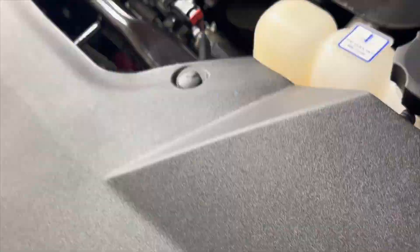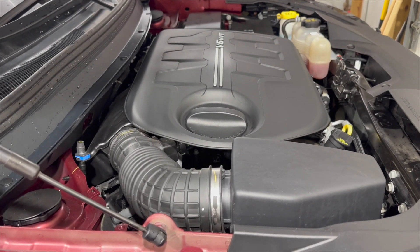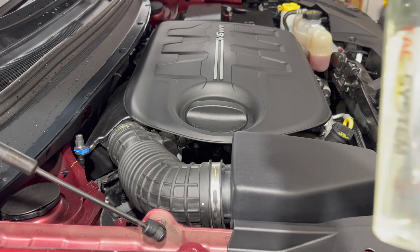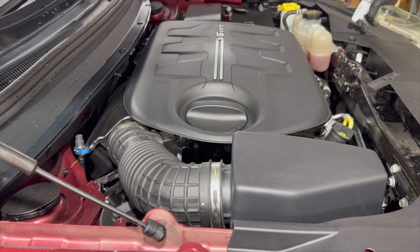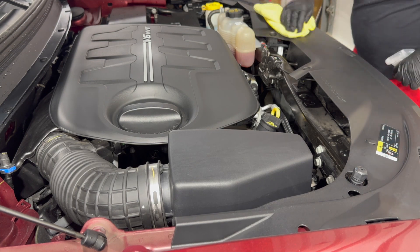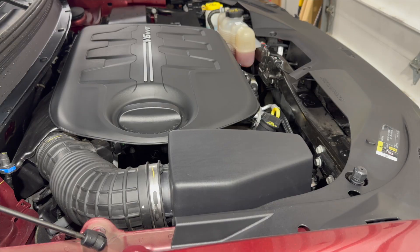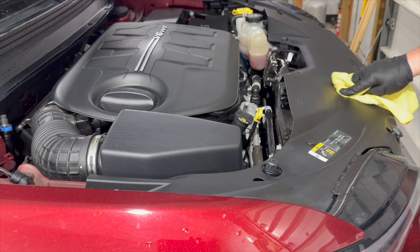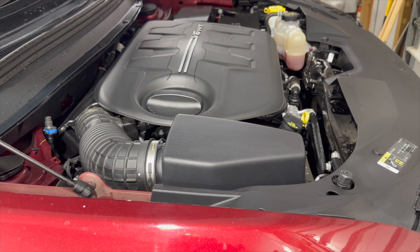As we got looking here, there's like chalk or crayon-type marker — some sort of paint marker that was put on by the factory for whatever reason. We're going to finish wiping this off. We're going around with our Tac System Tar Zero. This stuff is excellent at removing tar and any kind of double-back adhesive or mark that is just about a step below a wax and grease remover or lacquer thinner. If Tar Zero doesn't remove it, you're going to have to go to something a lot stronger.